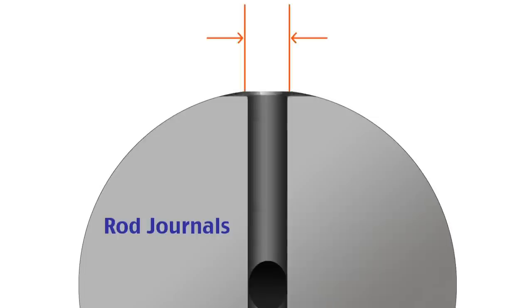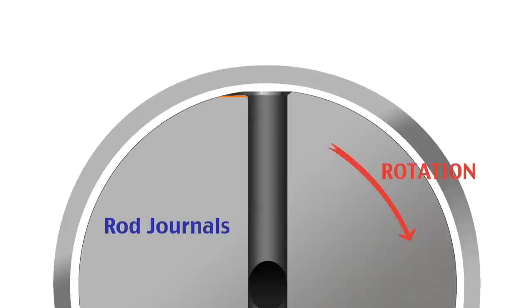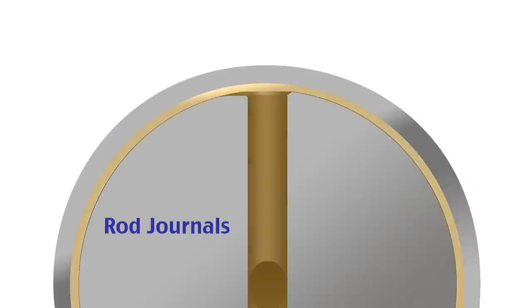We're enlarging the length and the size of that chamfer so oil is applied over a larger surface area when it passes over the bearing. Some people insist on cutting these directional with a longer trailing edge, and that's fine — you just have to think about your oil supply wherever you're doing this. Oil flow is directional. The directional chamfer theory is that a trailing chamfer pulls the oil out across the bearing surface as the oil hole passes over it, with little benefit in it pulling in front of the hole.